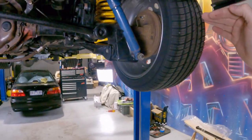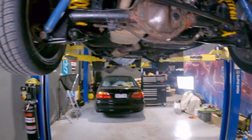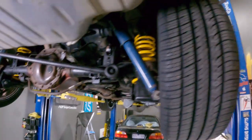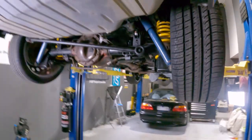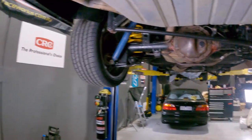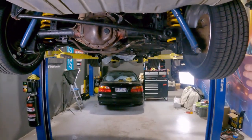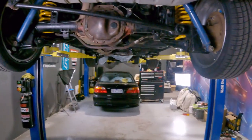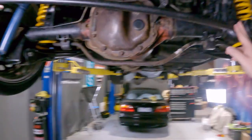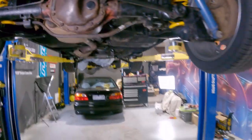You lower the car it's going to push everything that way. So I asked myself how am I going to combat this? I intend to get this car hooking and booking and going pretty fast down the quarter mile. I don't want the back of the car pointing one way and the front of the car pointing the other way. So we need to go for an adjustable panhard rod, and what that does is pull the diff back into alignment. It's very, very important.